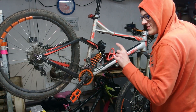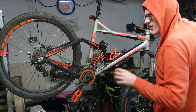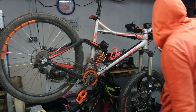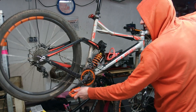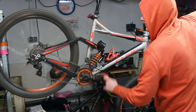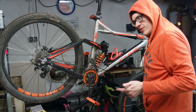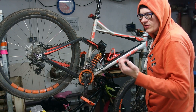The reason for that happening is that this is a Z which has a very strong clutch because I set it like that, so there's a little bit of hysteresis here — it's not really noticeable when you're riding. As you can see I'm on the biggest cog on the cassette and there's still one extra click on the shifter which I can force — I probably shouldn't but I'm doing it anyway. So: 11 speed shifter, 10 speed cassette, 10 speed rear derailleur — everything works well, acceptably at least.